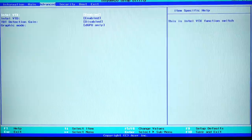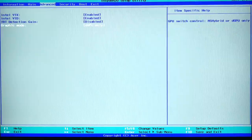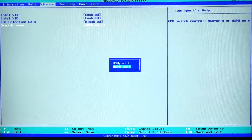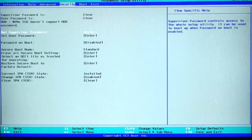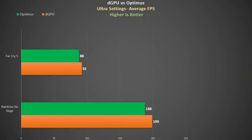Whilst using the Nvidia card you have G-Sync capability which is awesome. With G-Sync on I was still able to get 3 hours of run time, which isn't bad. Or if you enter the BIOS you can change it to Optimus mode, which is useful if you want the 6-hour battery life and you have software that can take advantage of the Nvidia GPU. Note though that you do take a frame rate hit when using Optimus.